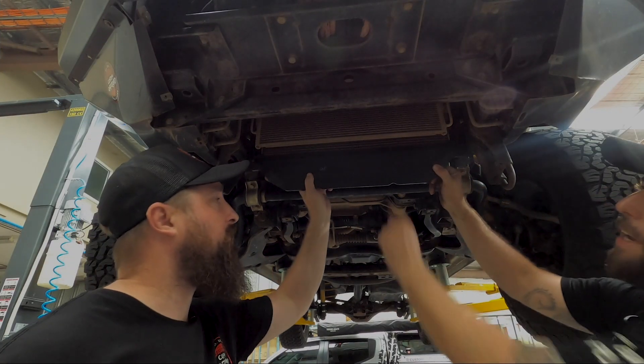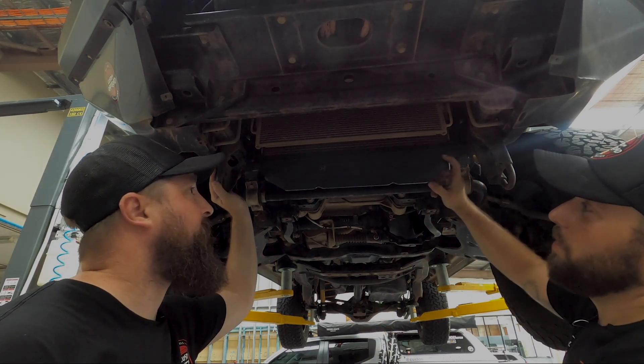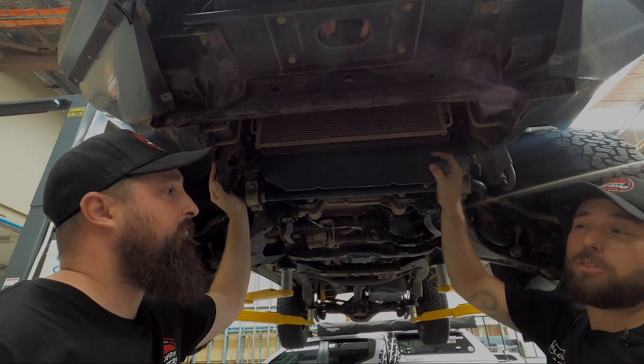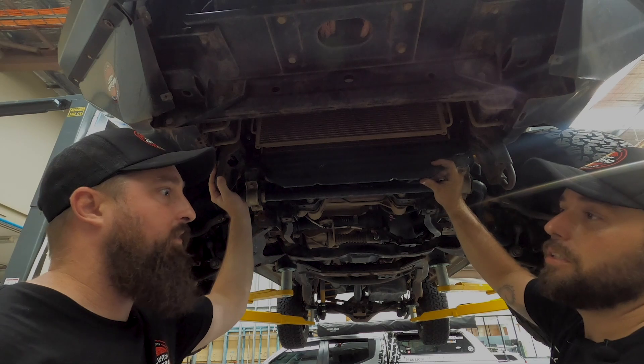This is the panel air guide or wind deflector. It's designed to direct wind up there. With the design of these plates, we can either trim it up or take it completely off. I took it completely off on my own vehicle because on the Cape York trip it was sending red dust up and just clogging up the motor. So the decision here is to take it off — we'll just need the 10mm and then we'll start removing it.